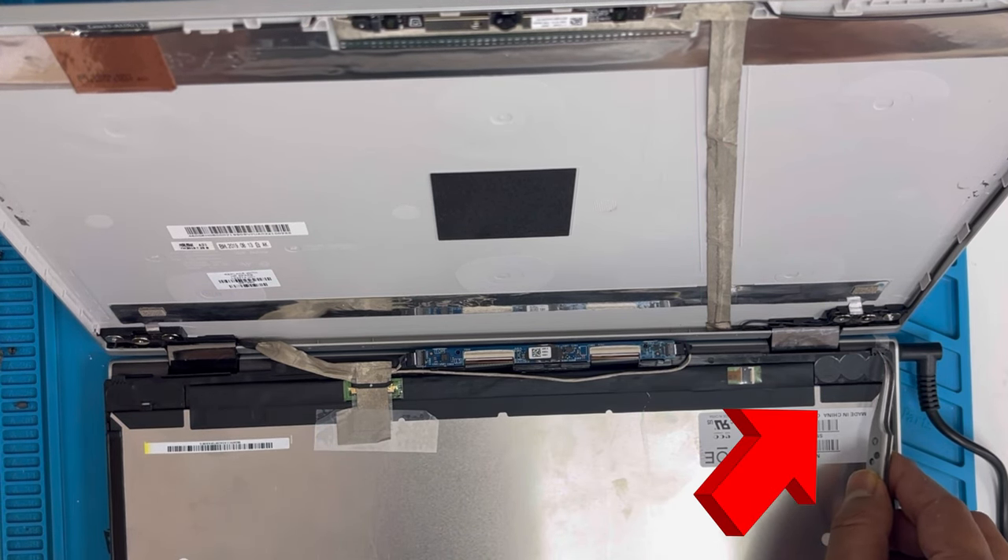Here are the two locks — one here and one on this side. This tool lock goes inside the frame. Slowly we're going to push it in. We don't want to push it all the way in first — check the bottom side is close enough. Once the bottom side is close enough, we press it on the top side. Make sure it is on center, then it goes inside easily. Press it — we have almost done installing the screen. All sides are closing nicely. I'm going to check the screen again — yes, it's working! The laptop is fixed.